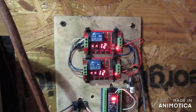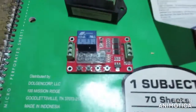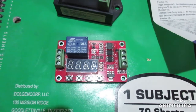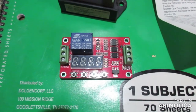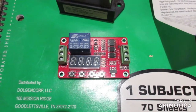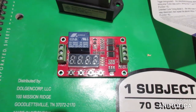This here, by the time you buy the parts and put your time into it, you'll have maybe a hundred bucks into it. All that consists of is two of these boards and a linear actuator solenoid. You're going to use one of these boards to control your starter and that solenoid to apply the choke to get the engine started, and then a second one to control the ground circuit for the ignition coil. In my system, both circuits are a ground sink circuit.